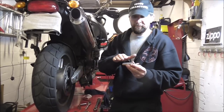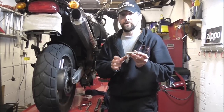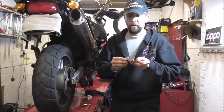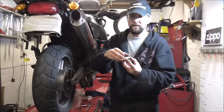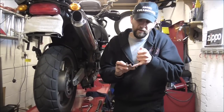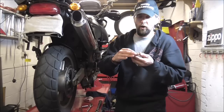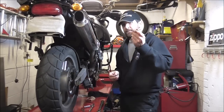So what you get is a copper mixture of copper itself and other compounds to do the job. It's bonded to the actual steel backing by heating the steel backing up so hot — virtually red heat — that it melts just a little bit of copper that touches at the back. So literally it welds or solders it on. That puck is soldered onto that backing, and these are just about the best pads you can get.